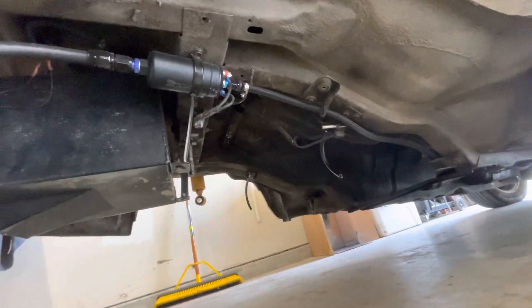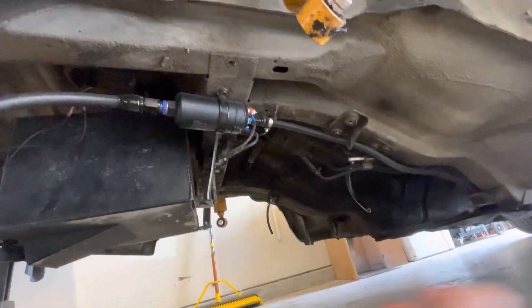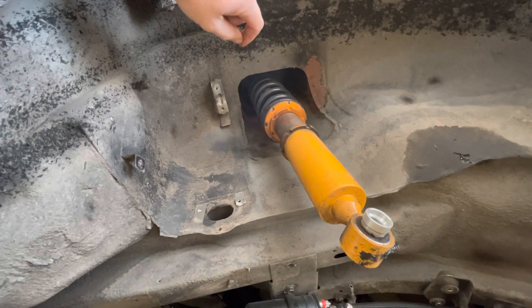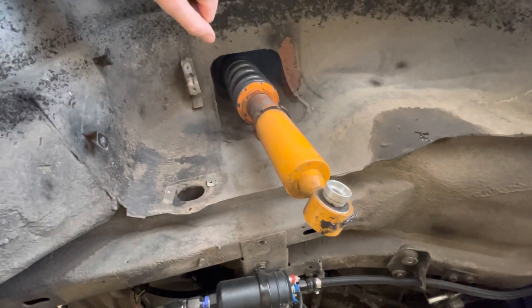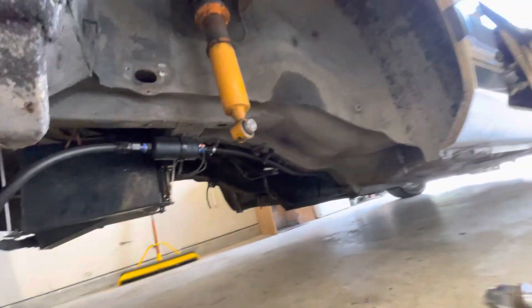I envision a possibility that I don't have to cut the whole floor out back here. My roll bar does tie into the upper strut towers on the inside, so it'd be real annoying to have to cut that out and relocate the shocks. I'm going to try to make these shocks work. Now we get to start really envisioning how this is all going to come together.